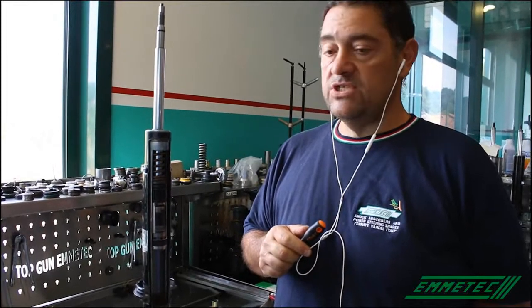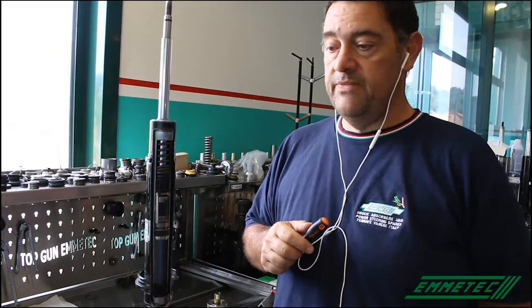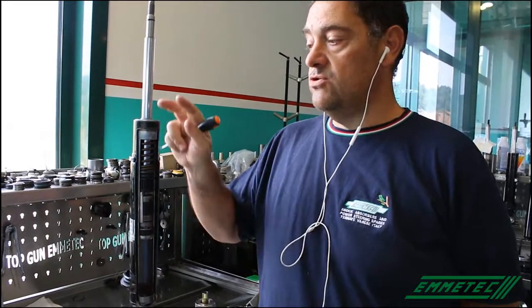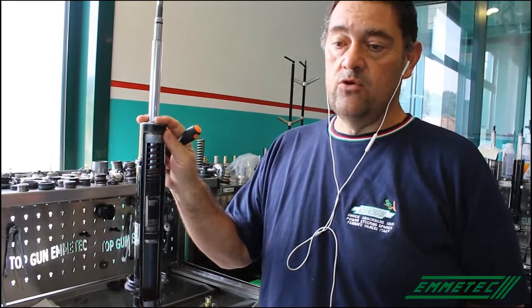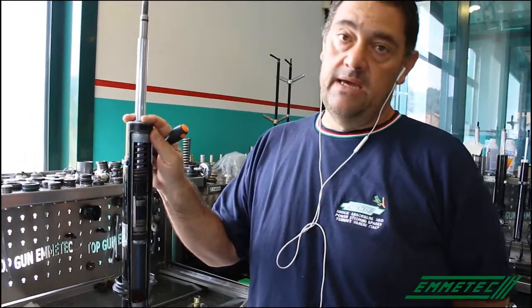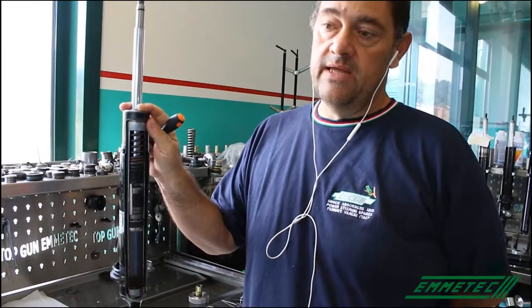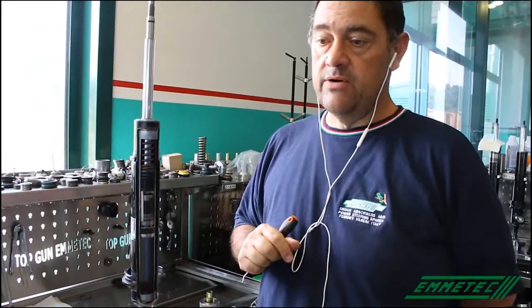In any case, consider that the pressure will decrease quite quickly over time, because the oil seals of twin tube shock absorbers do not seal like a monotube one, where oil and gas are also separated by an O-ring.